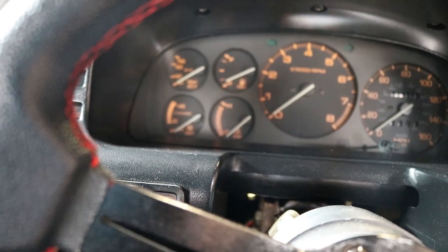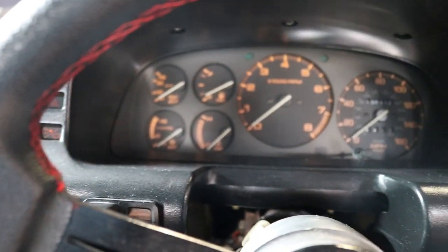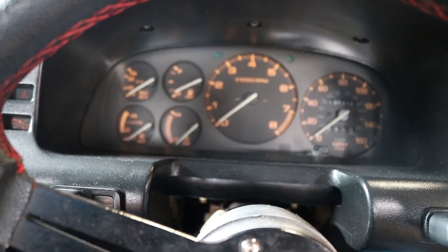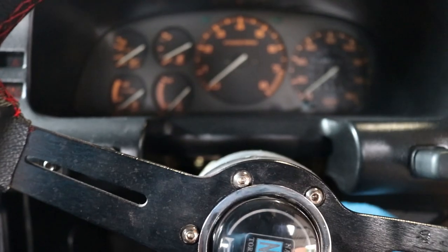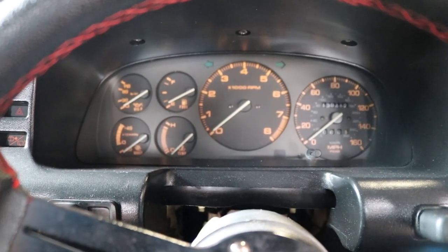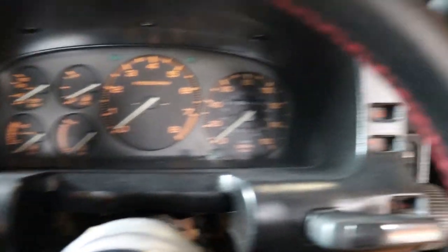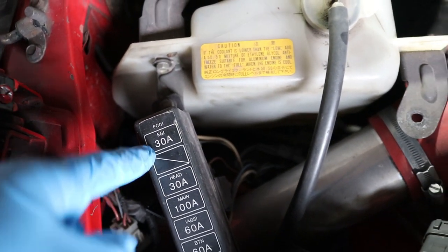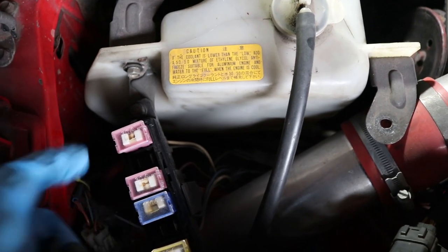Another important step is to basically make sure your engine has no petrol in it. So this will get your fuel pump fuse — crank it over a few times when you've got the spark plug out. You can hear that hissing away now, it actually sounds like it's good compression. My car is heavily rednecked so I don't actually need this fuse, but that's your EGI fuse — just remove that.